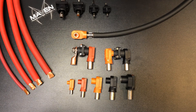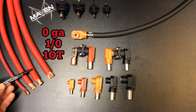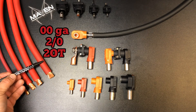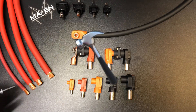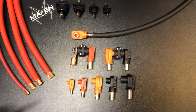Let's jump into the different cable sizes that can be used with these kits. From left to right we've got a 4 gauge, a 2 gauge, a 0 gauge — often written as 1/0 or called 1-aught — and a double 0, often written as 2/0 or 2-aught. Most people watching this will probably be using a 4 or 2 gauge. The person who uses a sledgehammer when a 15-ounce hammer would do will end up using a 0 or double-aught, or in applications where a lot of power is running through a car, you may need a larger cable size.